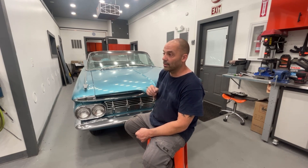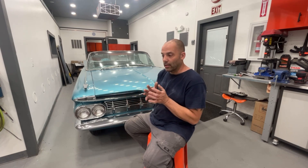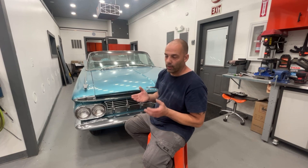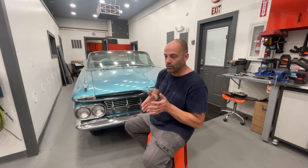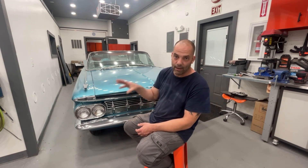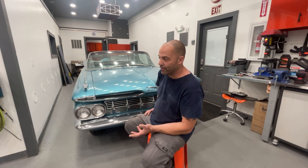Once both of these projects wrap up in the next couple of weeks, I should be ready to start painting the dually — the bed, tailgate, tunnel cover, and rear wheel flares are all ready, and the truck itself is nearly ready too. I did a spray-out for the owner but the pearl coat came out too gold; he wants it more bluish. The color is called White Lightning, a GM color, and apparently there were three or four different White Lightning codes, so clearly I had the wrong paint code. I gave him a panel with half original paint and half spray-out so he can match it at the paint store.